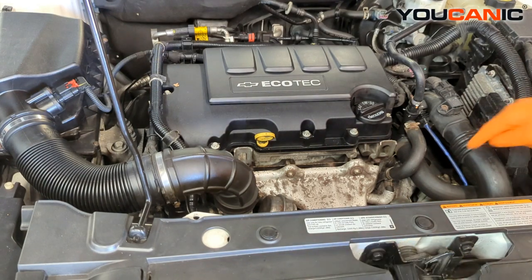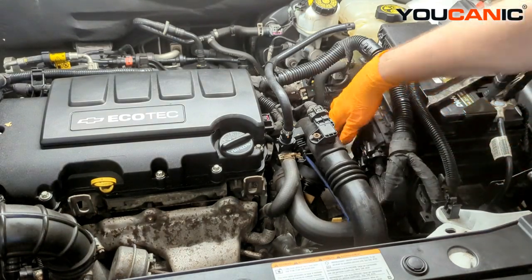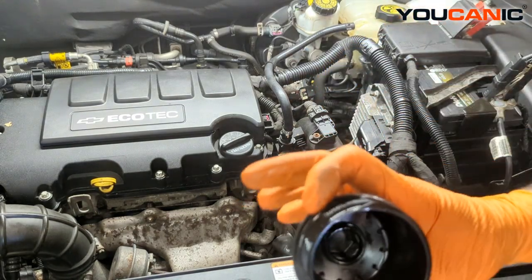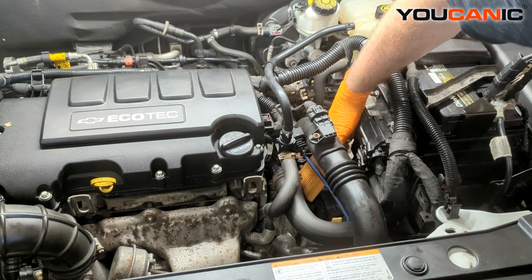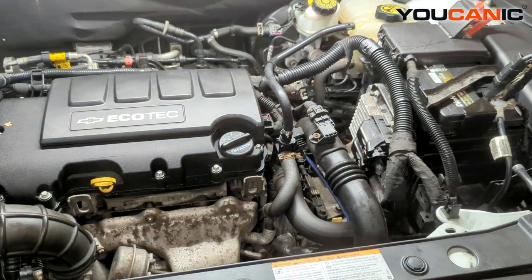It's showing low oil pressure because we don't seem to have any oil pressure in here. I'm going to take that cap off and look at the oil filter, and we'll be right back. We've removed that cap and we're going to pull this cover out. We can see we don't really have a whole lot of fresh oil there, even though we did just run this. We also don't have oil in our oil filter — it's dry. The oil is not coming in there.